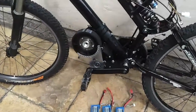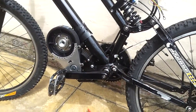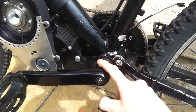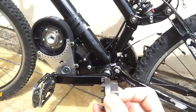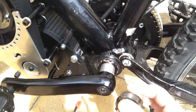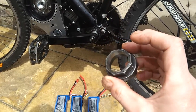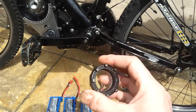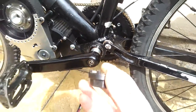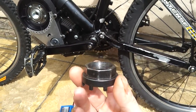Lightning Rods is on there and we've got it fixed on the bottom bracket now, thanks to a loan of a tool. You need one of these things — it engages with the castellations around there. Normally when they come, the hole in the middle's not big enough; you can't get it round the shaft, so you've got to machine it out. Luckily I've got a friend who's already done just that. The middle of this is just a standard Park Tool socket to engage with these, and we've just milled the middle out — he did it on a lathe.